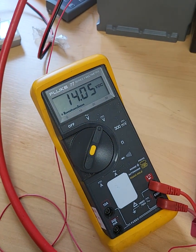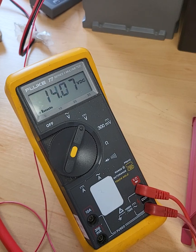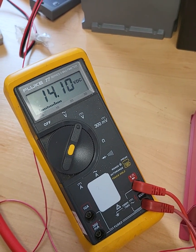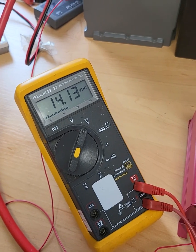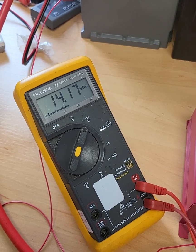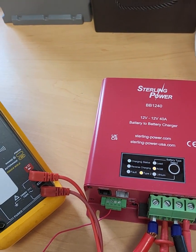The reason for the quite slow change in voltages here is because I'm charging a 200Ah lithium battery. That's why you don't see huge dramatic changes in voltages — because the battery is very healthy, very low resistance, and it's 200Ah. Charging state is still on there.